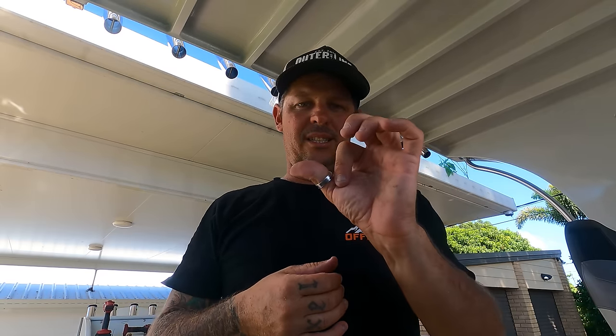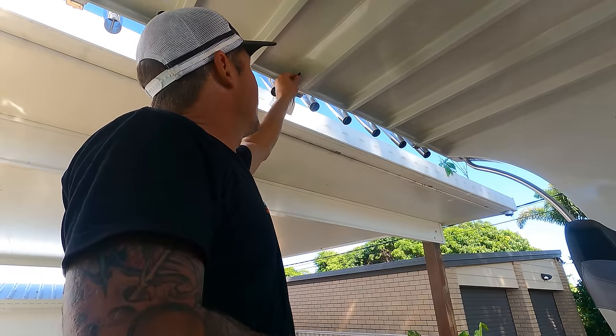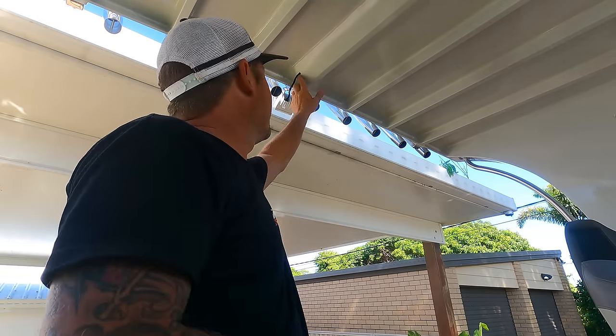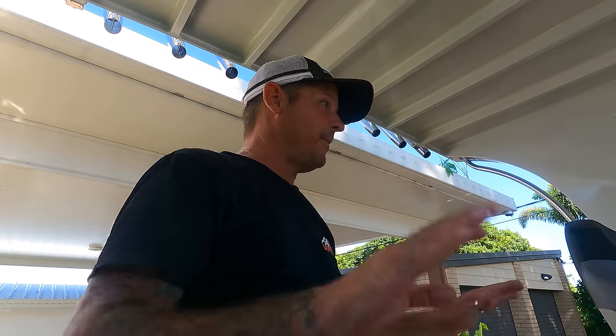You got the wire, you got the red and black outer sheathings, then you got a thicker white outer sheathing, then I've got a heat shrink over it, so that's not gonna earth and rub through that at all. Plus I also rounded the hole on the outside here out, so it's not a sharp edge. So happy days. All right, school pick up, back here, wire it up, and I'm done.